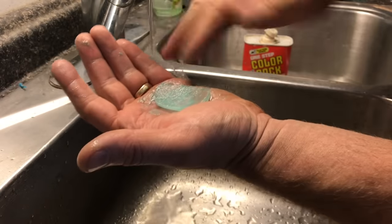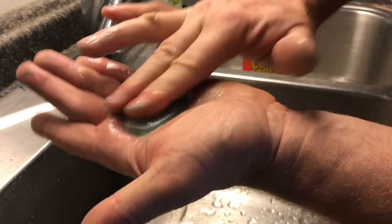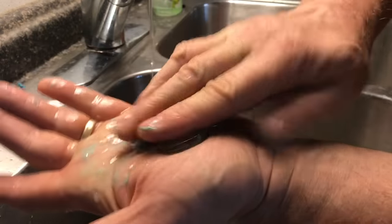I do see some small scratches on the back, so I'm going to take the 1200 grit sandpaper and start to work those scratches out, then back with the toothpaste. Just keep some water on the toothpaste to keep everything workable. If you want the toothpaste to work a little more aggressively, use a little less water.